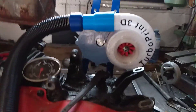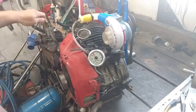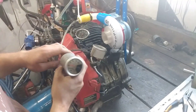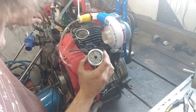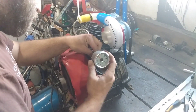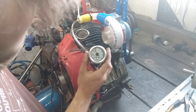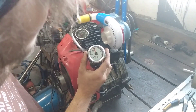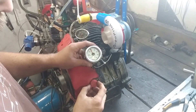After everything's broken in, on to some initial pressure testing. Currently I'm running about one-to-one on the belts with a 3.25-to-1 gear ratio on the gearbox, which gives me a maximum of about 12,500 RPM with an input of 4,000 RPM. Four thousand RPM on the bench with no load is a little sketchy, so I'm probably bumping around 3,000 RPM — though I don't have a tach hooked up so I'm not exactly sure. Between both gauges I'm seeing about half a pound to one pound of boost. These gauges aren't very accurate, but if I see 2–3 PSI on them, I know I'm making a clean 2–3 PSI.